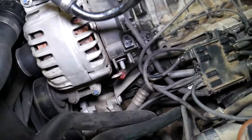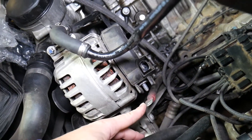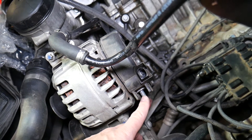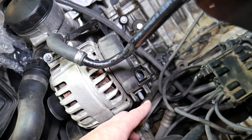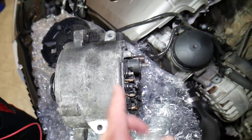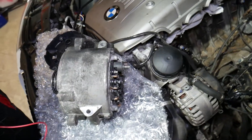After you do that, you need to find where the 12 volt charging wire from the alternator goes to the battery and disconnect that wire. In our case for that alternator it's the one right here — we removed it. Now this is the other alternator; the charging wire is actually on the back side on that good one, but it's the same design.